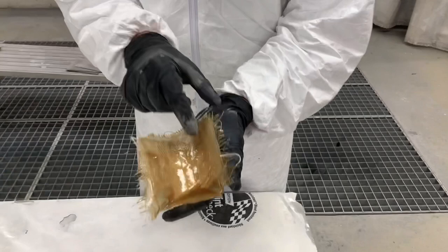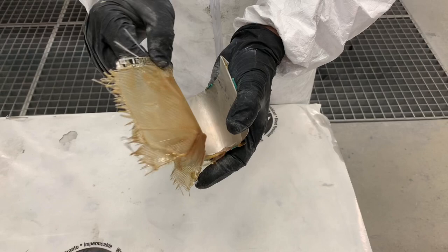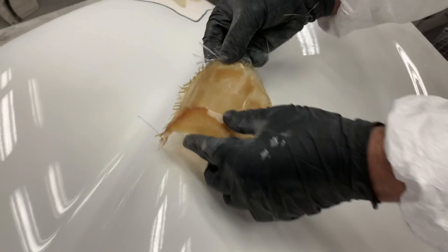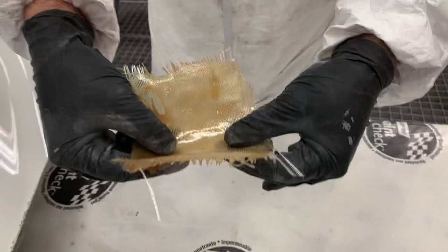I set the piece up at an angle so the resin could flow to the bottom instead of pooling, and once it's cured and hard it just pops right out of that mold quite nicely. Then as mentioned we can grind as necessary and reattach to the panel from the inside or outside to match, say, the curve of a hood. This is just a demo — and this is the longest video I've made to date. Thanks for watching!